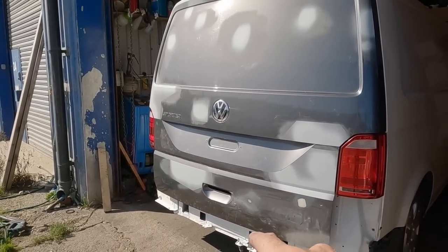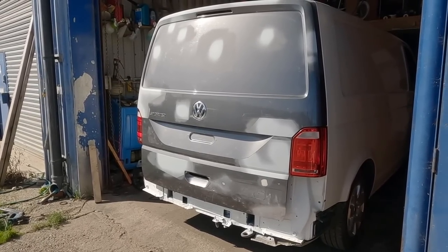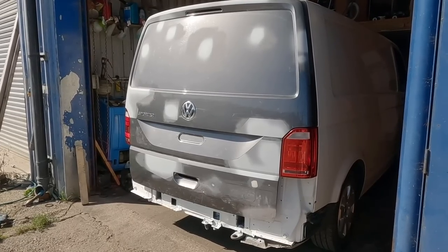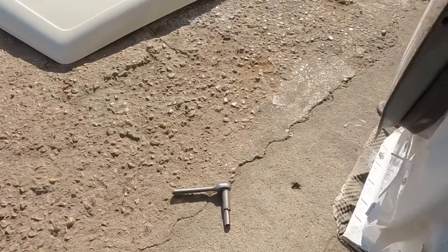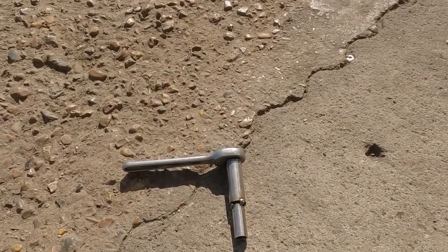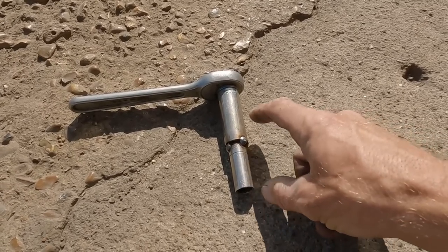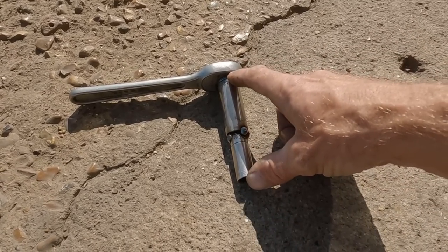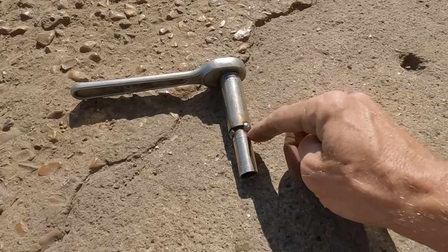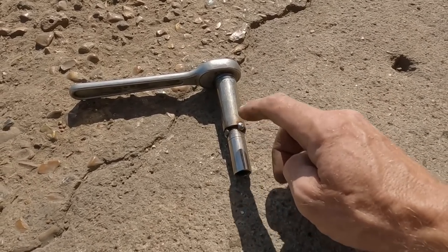I need to try out the striker on the bottom — I'm waiting for a new handle to turn up. That's today's progress. I'm going to fiddle about with a few more bits. Just quickly: to undo the inner hinge bolts it's a 12 mil socket, but the bolts are long so I welded a 15 mil socket — you could use any size — just to extend it. I welded two together.